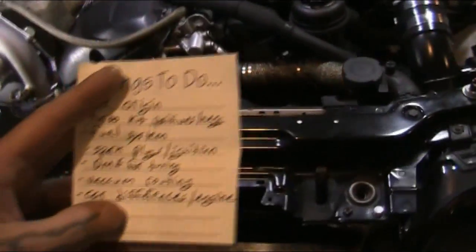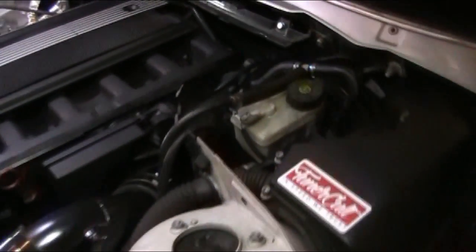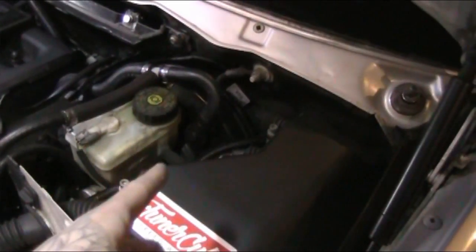And another thing on here is going to be vacuum routing. Now, what you can do on these cars to get a good source of vacuum, you can splice into your brake booster hose. Okay, you're going to have two check valves, one in the brake booster and one in line right here. I think they call it a suction jet pump, but you can just delete that because you already have one check valve. I utilize that for blow-off vacuum.